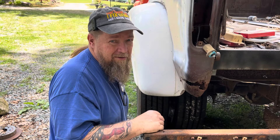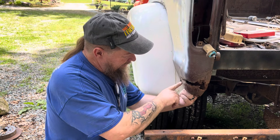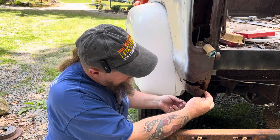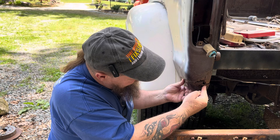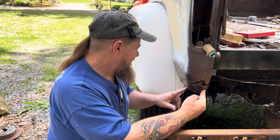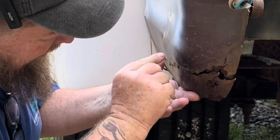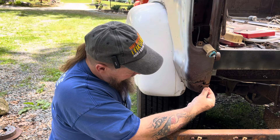The first thing I want to address is this floppy thing. All throughout here and on the bottom, this thing is pretty solid. What I'm thinking is we're gonna clean up the metal on this backside right here, put this back up in place, and tack it back into place. We're gonna cut this piece of metal out right through here and replace that, and replace this patch right here, or wrap a piece here and get that squared away. I think we can save it.